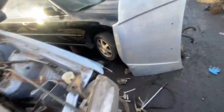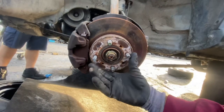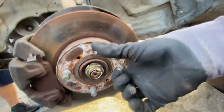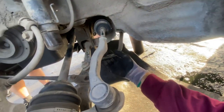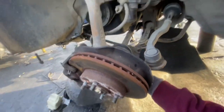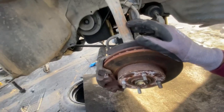Anyways, I'm currently working on getting all of the suspension pulled off. This is kind of a tricky one. It's always hard to bust off these axle hubs when you're in a junkyard because we never really have an impact that's strong enough to get this bolt off. So what I'm going to do is pop the axle out of the transmission on this side and then just loosen this lower control arm bolt, loosen the sway bar off, and get rid of the traction bar — hammer it down. It'll all fall down with the axle and we'll be done. I'll probably unbolt the brake calipers so we don't have brake fluid all over the place. I'm going to put you guys on a time lapse because we really only have like an hour to do this. Let's go.